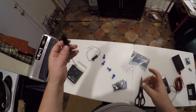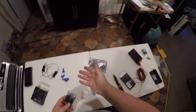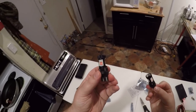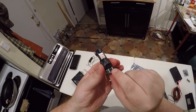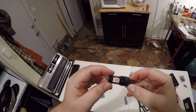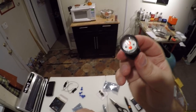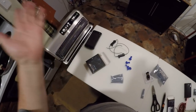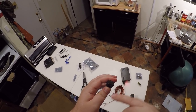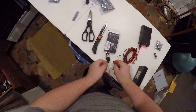So those resistors are there in case the bulbs don't work. Here are the bulbs - the reverse lights are about $16 and this whole kit is about $25. Look at these: plastic bottoms, folded metal because that's what the bulb takes, very thick all-aluminum heat sink with aluminum knurling. Three sides with four emitters each side, and then a projector lens on top. My brake lights are also my turn signals, which is why there are two sets - so I'm not 100% sure how this has to be wired, but we're going to give it a shot.